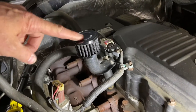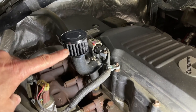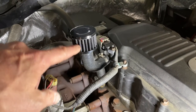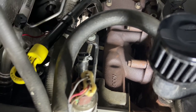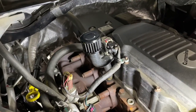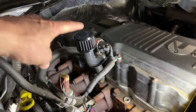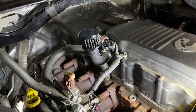We're done. You've got your main hose with the filter on top, allowing your crankcase to vent and catching any excess oil. If it ever gets clogged or starts dripping, just take it off and wash it out; if it gets destroyed, replace it — they're very cheap online. Down below, I just used the pinch clip to secure the plug, since getting a screwdriver down in there around all the hoses and brackets was too tight. The plug goes to your intake, the filter is on top, and we are good to go. Any excess blow-by oil will vent to this filter and won't keep recirculating back down into the turbo.